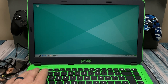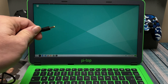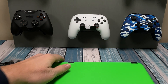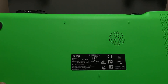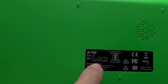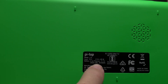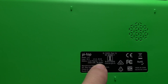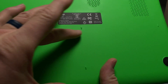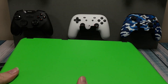Hey, so it turns out I was wrong. As I was putting this away after finishing recording, I took the unit out and the thing's still working. On the bottom there is a little label that shows the 18-volt, 2.5-amp input — the 45-watt input — but then it shows an 11-volt lithium polymer, 3,500 milliamp-hour, 38.85 watt-hour battery inside. So it must be behind where the keyboard tray pops out — but it definitely has a battery inside, so I was wrong about that.